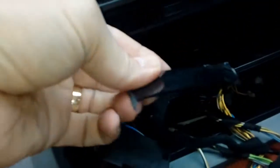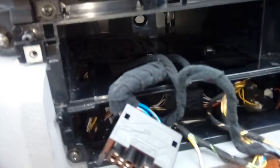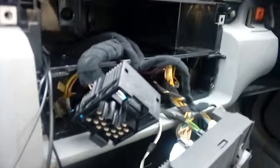This particular radio has needed the piece of plastic removed. What that means is we can now push all these cables down behind the heater nice and easily. You don't have to do this - it's just if you're fitting something with a lot of wiring behind it and it won't shove back and fit neatly. It gives you that little bit of extra room. We've spent a couple of minutes just feeding our cables up from below - the aerial and the microphone.